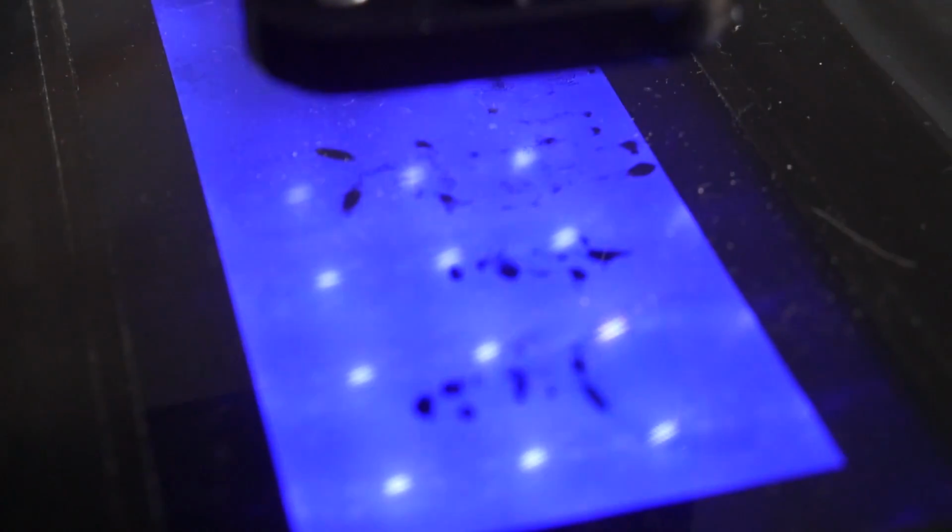It wasn't until I was cleaning out my FEP tray and doing a quick cursory check of the LCD that I found the problem, which was dead pixels on the LCD starting to pop up well, everywhere.